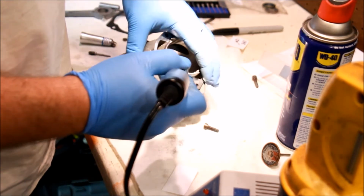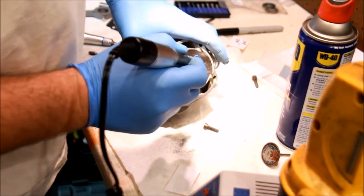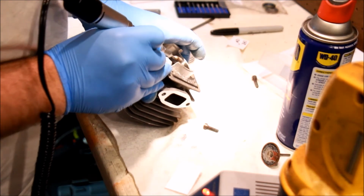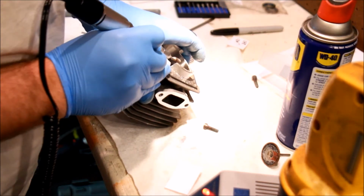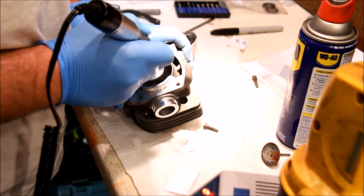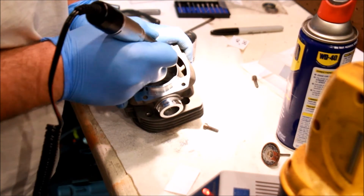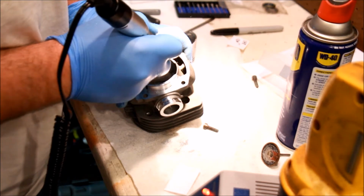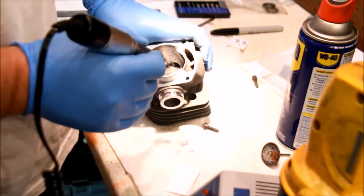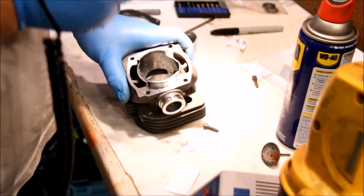That seems to be working pretty good. And in here, what you might want to do is take this down first. I usually like to have this straight here, so take a cut down. Not exactly the right burr to get into this corner, but yeah, not too bad. So now you can see how I'm blending that. The flow is nice and even across that. And I'm going to want to go in here and grind that back just a little bit, so it's as straight up and down as possible.